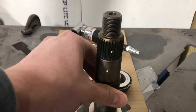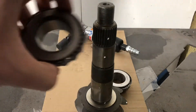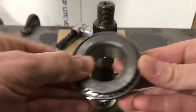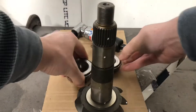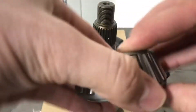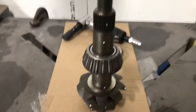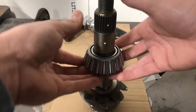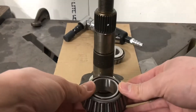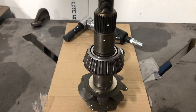To set up a ring and pinion, you actually need to get two sets of bearings. You've got a large one and a small one, and they go in different areas. The larger bearing especially is a press fit — see how it goes on and stops? Before you're done, when your setup is correct, you would generally shim this area right here, and that would set the height of this bearing, and ultimately you would adjust your pinion clearance.